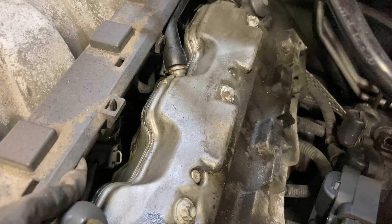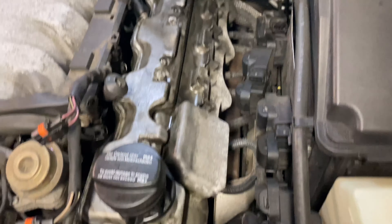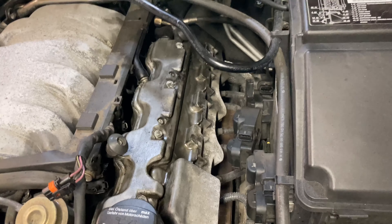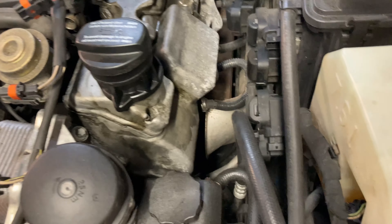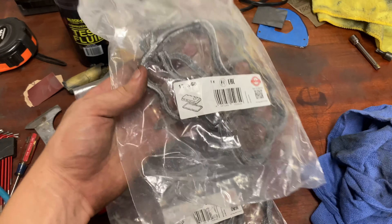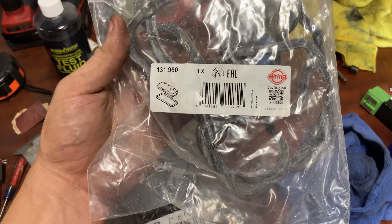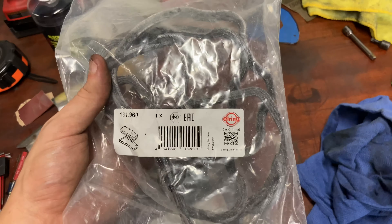I was blowing the top side out with compressed air and just took the coil packs off, so I'm going to clean out this area as well and then go from there. All the coil packs are just sitting on the side right now. I'll clean the side off a little more — it doesn't have to be perfect since once I get the cover off it'll be easier. Just need to get all the big debris and crud out of the way so nothing falls in when I pop them off.